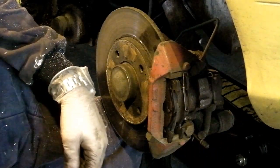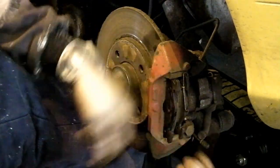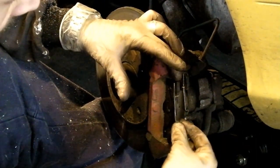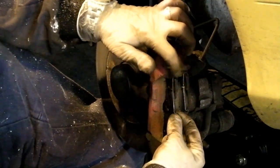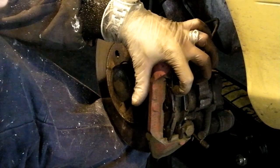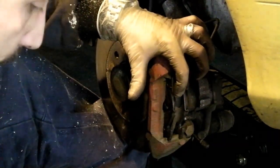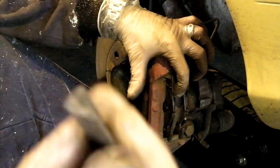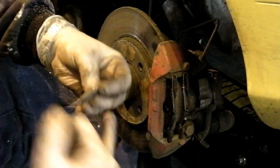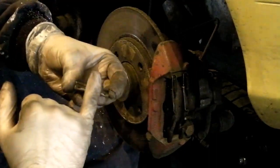Anti-rattle springs — some you need to fit onto the pads before you fit the pads, some you need to hold everything in place while you swing the caliper back on, and some you can fit on afterwards. If you can fit them on afterwards, do so — it saves a lot of hassle. In this case, just lift the top of the pad out, hook the loop over there, push that up and make sure the top of the spring sits on the outer body of the caliper. Push that in and up as far as it will go. Same with the other side — basically what this stops the pad doing is rattling around in there and annoying the pants off you. So take your locking pin, your L-shaped pin, after it's had a little bit of a dress-up on the angle grinder, and give it a quick swipe of copper grease just to help it slot into place nicely, on both the outer and inner surfaces — just a little bit, not too much.